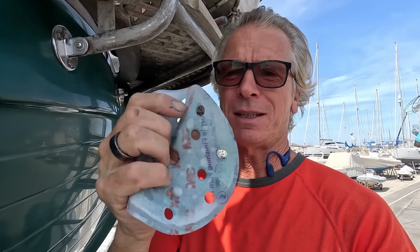Yeah, I've almost finished, but as you go round, obviously you get better techniques. You just get better at it as you go round and find what works and what doesn't. The major thing really is with these plastic finishing films from 3M, if you put too much water on, it just aquaplanes across the top, so you've got to get the water right.